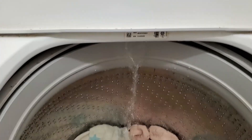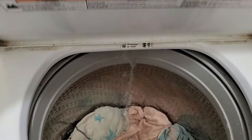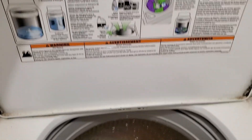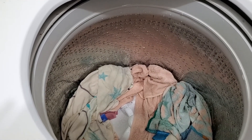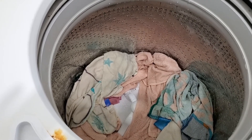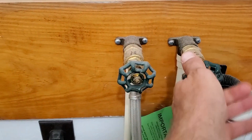As you can see, we're not getting a lot of water flow. What's happening here is it's not getting enough water flow to fill up the bin, and the computer is saying it has an overflow situation — the solenoid valve has been open for too long on the water. So it's going to shut down. A pretty simple solution to this situation.